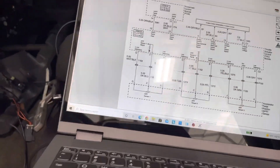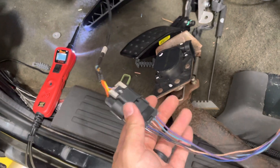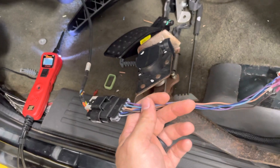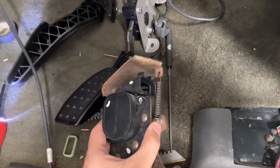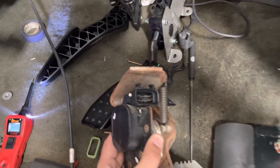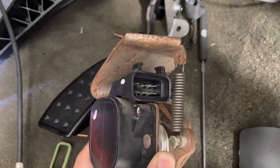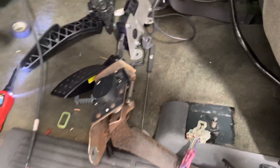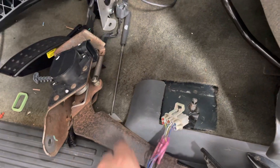So that's good, because that means we can match up those 6 pins if we know what Holley wants. What this guy did is he went and bought a Current Performance harness adapter, but the terminal ends on the plug side were wrong — they gave him male pins, and that's obviously male over there also. Whatever they want to be called, you get the idea. So that wasn't going to work, and what he had to do was take the factory connector and cut it off.